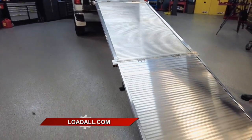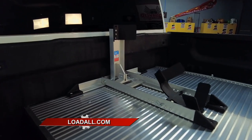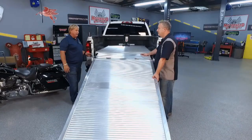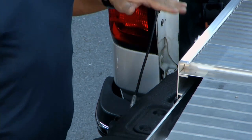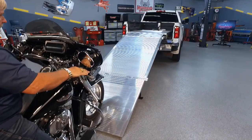Most bikes are so long that they're sitting on the tailgate itself. So how does that wear on it through the years? Well, eventually you're still relying on this to hold that bike on there — a couple of cables, that's it. These cables corrode from the inside out, so you don't even know they're bad. You've got two little green wires. If you could see it, you wouldn't do it, but you can't, so you do. And the next thing you know, this breaks or your tailgate ends up looking like a taco — with a nice bend in the middle.